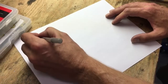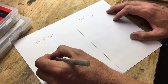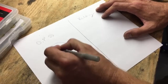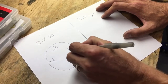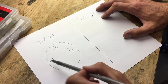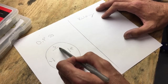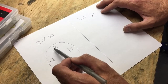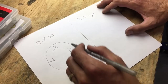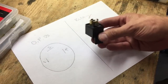Let's talk about these two electronic components we're using: an oil pressure sensor switch and a relay. The oil pressure sensor switch has three prongs — the first is marked I, the top is marked S, and the side is marked P. The I goes to your input, in this case we're going to put that to our ignition. The S goes to power only when the starter is engaged — this will help us disengage when the engine stops. P is power to the relay. A relay — a single pole, single throw — looks like this.